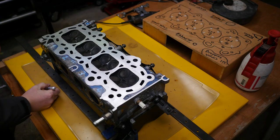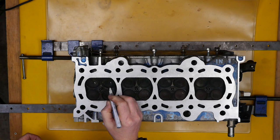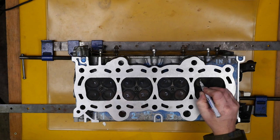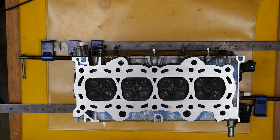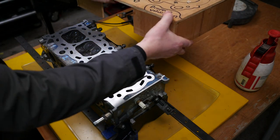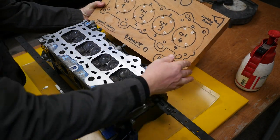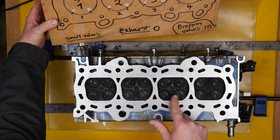I'm going to mark all the valves so I can be totally sure I don't accidentally mix them up, as it's important they all go back exactly where they came from. I'm using a white paint pen because that should mark onto the sooty valves. I'll mark all the valves with which cylinder they came from — one, two, three, and four — and further mark them A, B, C, and D so I can relate that back to the holder.